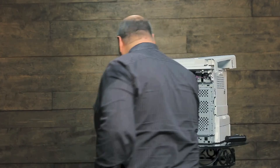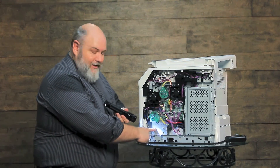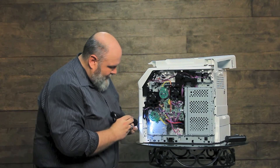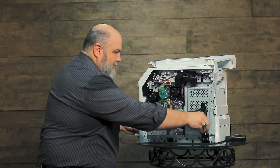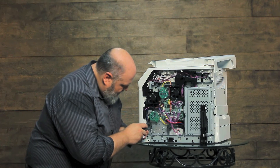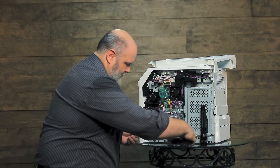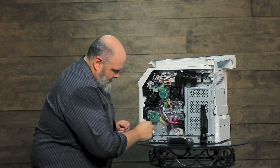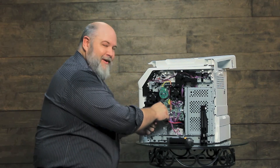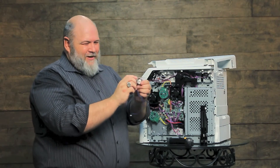Now what we're looking at here — right down here we have the pickup drive assembly, and right next to that is your pickup solenoid. That's what we're after — the pickup solenoid right here. I'm going to take the screwdriver, one screw. You're going to unroute your wire all the way back to your DC controller. I did this before just so it would go faster.